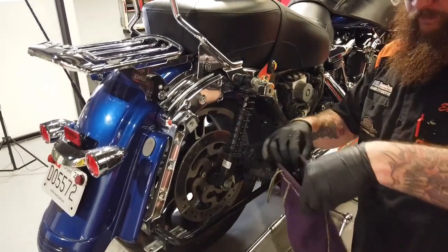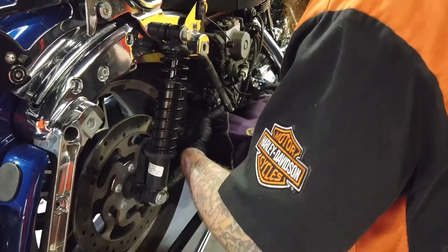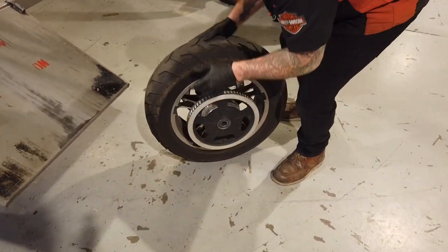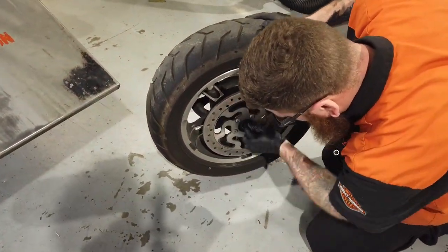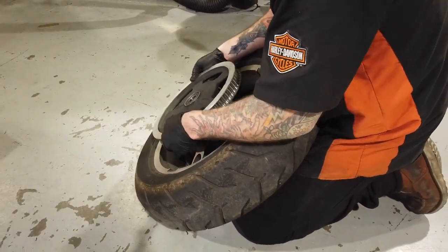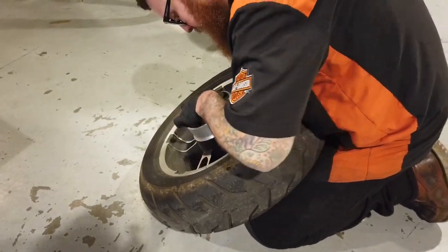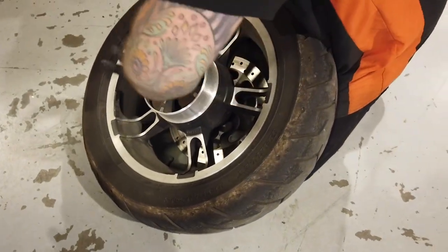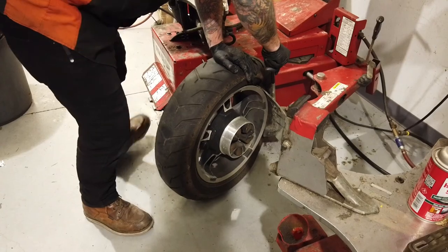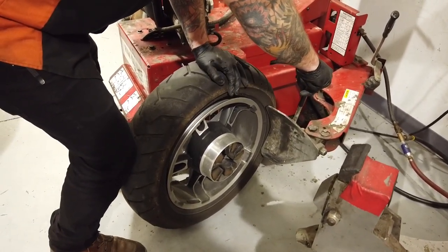This is a special little trick using purpose-built caliper bags — that's just to protect things and keep metal-on-metal contact from getting nicked up. Two really important things to check while the wheel is off: the sealed wheel bearings, which are fairly durable but very difficult to check until you get the wheel off. When you spin them with the wheel off, you can feel whether they're smooth or crunchy — if crunchy, they need to be replaced. Also check the rubbers and their fitment with the pulley. In their experience, these things generally last about a tire and a quarter. Make sure the tire iron is not too far from the rim, or you won't get sufficient leverage — and if you nick the rim, that's going to cost you a wheel.